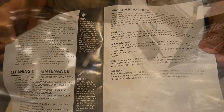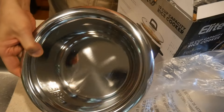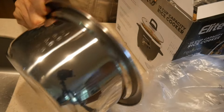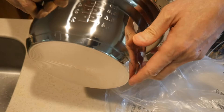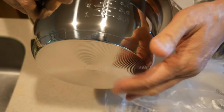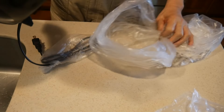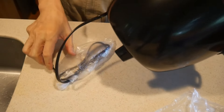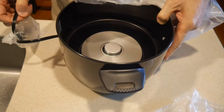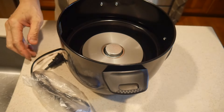In this particular rice cooker, I'm particularly interested in the stainless steel part. As you can see here, this is an excellent stainless steel part. I really like that the bottom of the pot is enhanced with a multi-layer clad, which means it has better heat conduction. The auto-cooking part of the rice cooker is very simple. On the inside, it has a heating plate, and in the middle it has a spring-loaded switch.